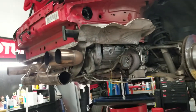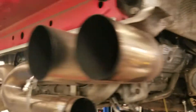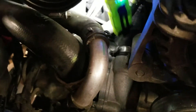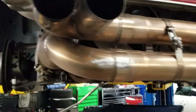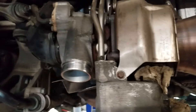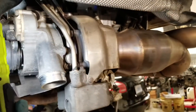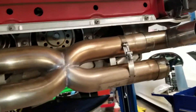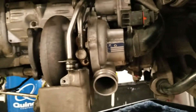The injectors also have to be upgraded. One of the biggest items is replacing all the coils — there they are right here — along with brand new spark plugs. The cooling fittings need to be pinned on this one; no one's ever done them and the good news is they've never slipped. There are seven cooling fittings that need to be either pinned or welded — both are accepted methods if done correctly. You can install them back in, pin them, and they become basically one unit and will never slip again. Welding works too, but welding billet fittings to a porous metal can be a problem if you don't have a very good welder.